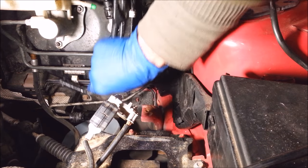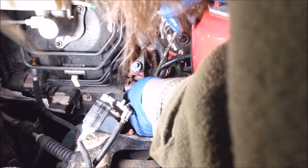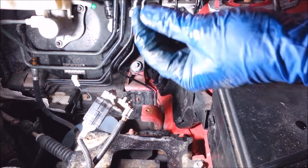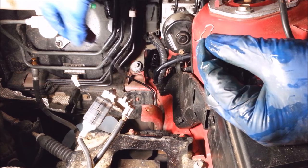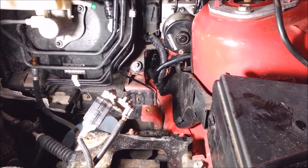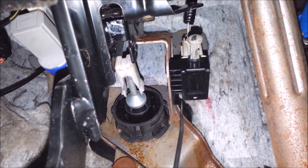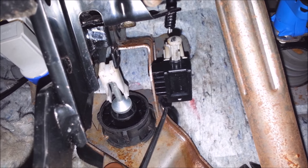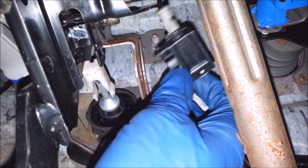That made a minor mess. There's another metal clip on this — the clip is on the bottom. I got that clip out from underneath using a pick; it's hard to see, everything's black and buried. What a dumb design. You've also got a couple of clutch switches to take off — there's a little tab on the back you pull out of the way and it pops out.